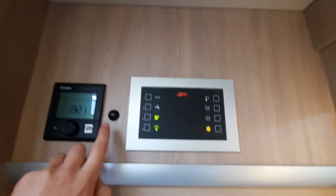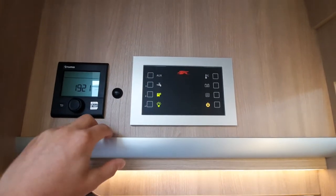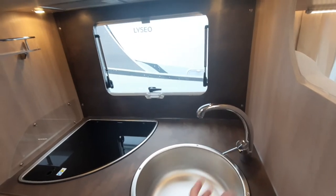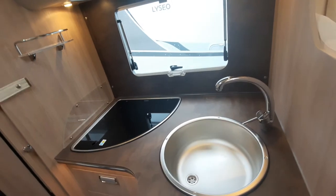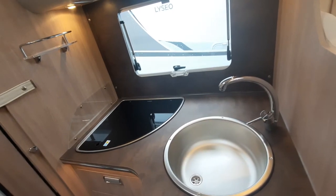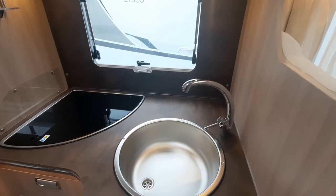Make sure that you don't run the pump without water in the system, as it'll burn out the pump. What you need to do is, once you've filled up, come to this and click this button to activate the pump. Then go to all of your taps, including your shower, turn it to hot and turn it on. That's going to prime your system — it's going to drag water through the fresh water tank, through your pipes, through the boiler system when you're doing it on hot, and it'll spurt out. Once it's running steadily, you know that you've primed your system. Once you've done this on hot, you need to do it on cool — flick it over to cool and do the exact same. Once it's running steadily and you've primed it, all you've got to do is leave the pump on, because each of these taps are on isolation switches, so it'll only activate the pump when you need it.